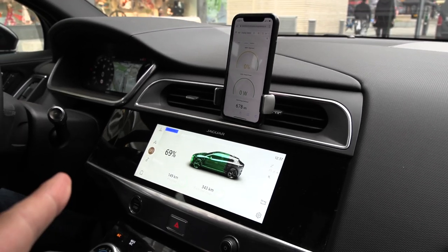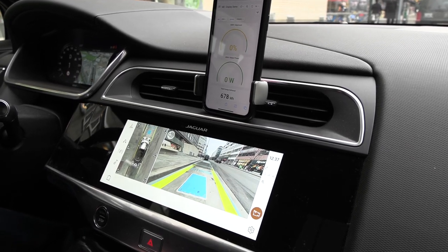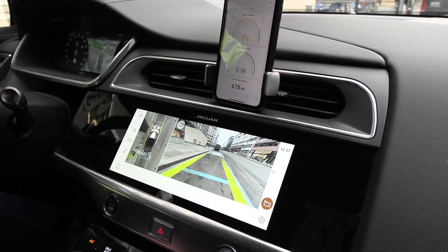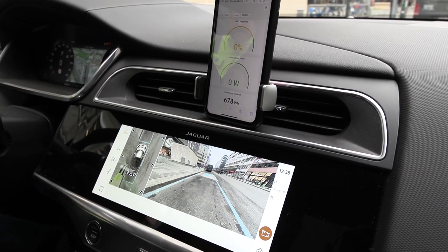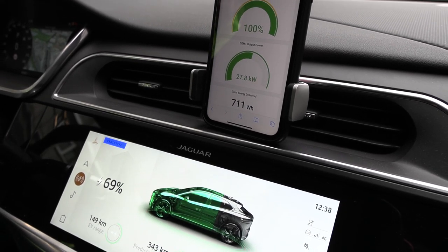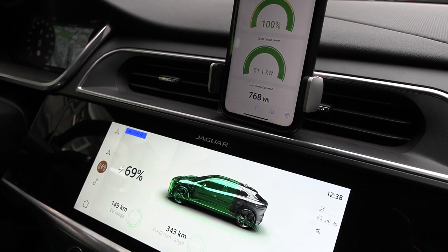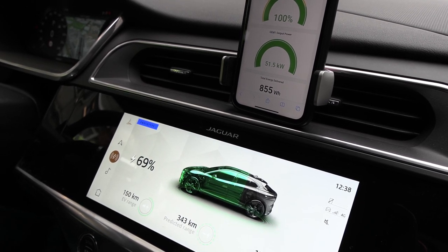We drive forward up to 70% — that's going to be our starting point. We will charge from 70 to 90 percent. The battery is warm-ish, that's also a big unknown, but we will try to estimate based on what we know. We don't have any OBD connection here. So now we're charging — it's not ramping up yet and we have to get ready to move exactly when it hits 70 percent. We're seeing about 50 kilowatts, which means the battery is not that cold.